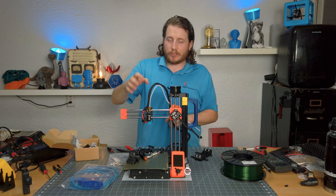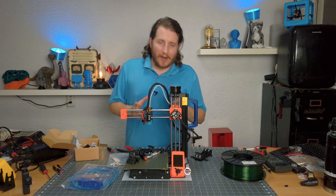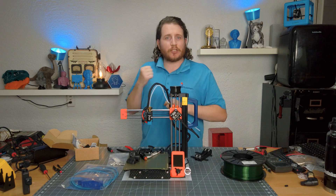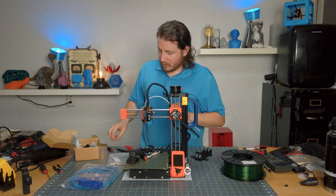While the speaker was talking, I completely disassembled the hot end, pulled the nozzle out, and torched it to clear the clog — because I was on the road and I didn't have any of my tools with me. It actually worked out really well in the end.